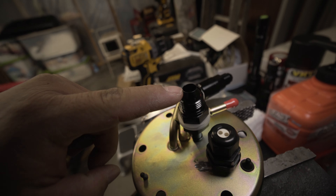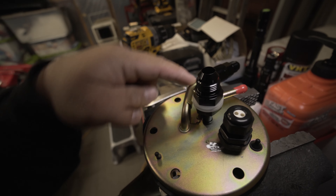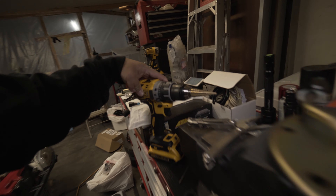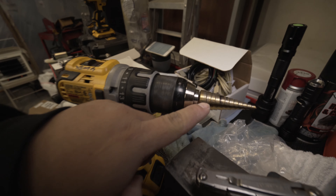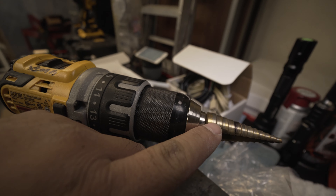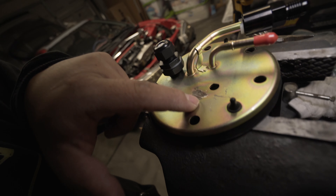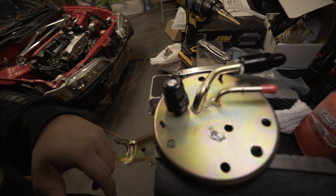How they do their kit is actually pretty smart. The OEM sends fuel out on one line and it comes back on the return line. What they're doing now is you swap these lines - you send it out on the new larger line and the return is now coming back in on what used to be your feed. So instead of a six-feed and four-back, you have an eight-feed and a six-back. It's actually exactly what the doctor ordered.